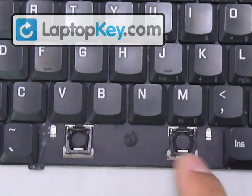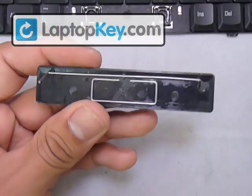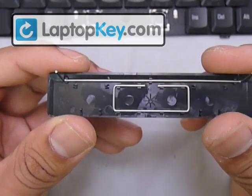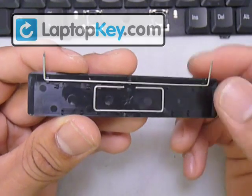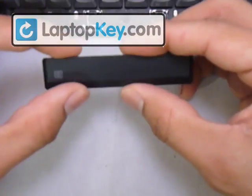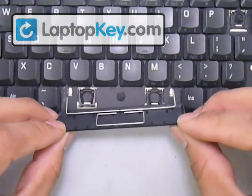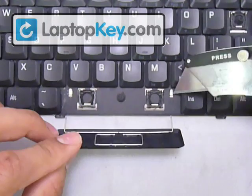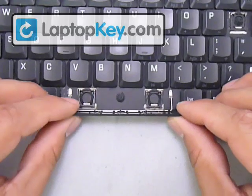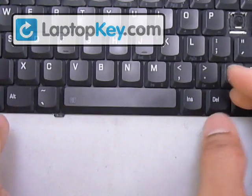For the spacebar, first you put the hinges and then the rubber cup. What changes is that behind the keycap there are metal wires. This is the right position for those wires — you can copy off the video. Once you have those wires in, open up the wire and turn your key to the right position, which has the top cut square and the bottom at an angle. Flip your keycap over so you can see the wires, then insert the wire into the fittings at the very right and very left. Once they're in, turn your key over onto the hinges and push down evenly on all sides. And that's it.